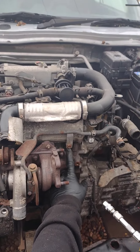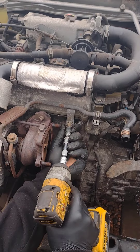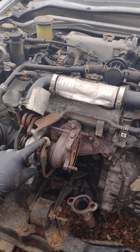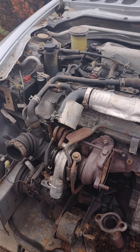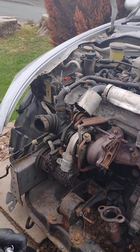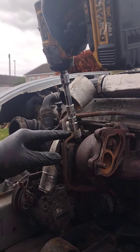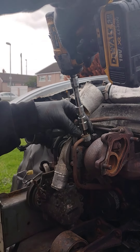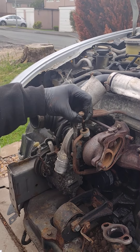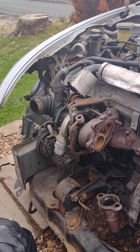We're going to start off with this bolt here. After removing all the cat, we're going to take this bolt out of the way, which is this pipe right here. And then we're going to loosen this bolt on the top of the actual turbo pipe. I'll just change the sockets over. So we're going to take this bolt right out the top. You do want to be keeping these bolts, so just make sure you put them to one side and remember where everything goes.